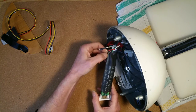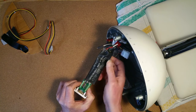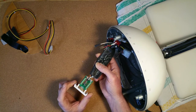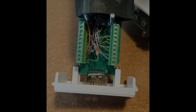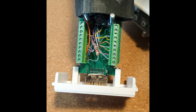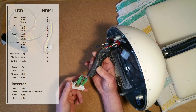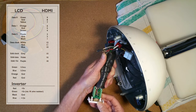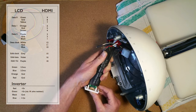If you try to solder these pins they can introduce sparkles into the picture. The best way to hook up these signals is to use an HDMI breakout plug or socket — I elected to use a socket and you can see it here. Once you have the wires free from their housings, strip the outer insulation from the LCD cable. Inside you'll see a number of coloured wires including four lots of three with an outer copper coloured wrapping. These are data zero, data one, data two and data clock. Inside each of these is two coloured wires and a clear wire which is connected to ground. All you have to do is use the pin outs shown to connect each of the pins and the job is done. I didn't have a piece of heat shrink tubing large enough so I cut a strip from an old inner tube to cover the breakout board and its connectors.